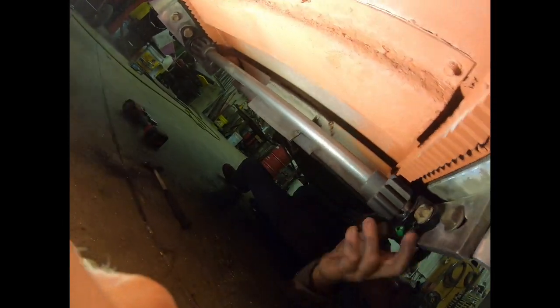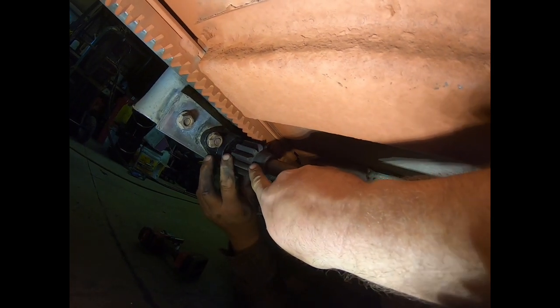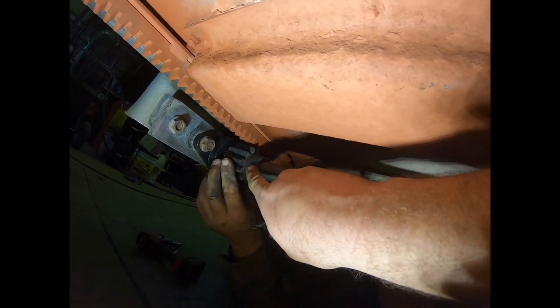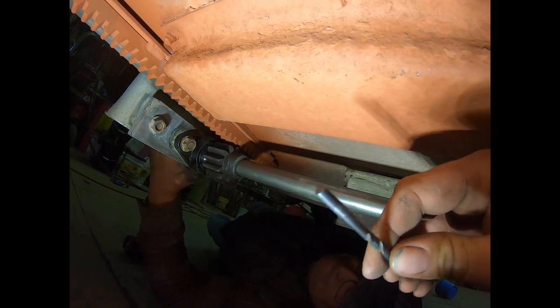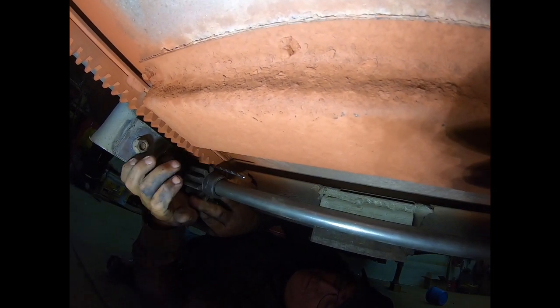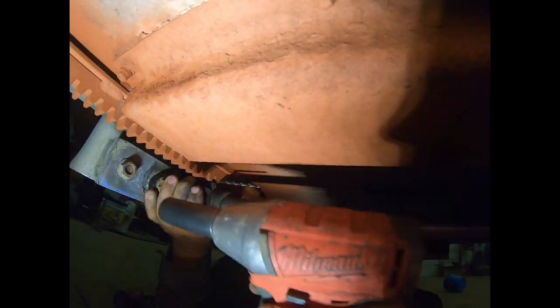We're ready to find our happy place for our gears in the gear strip. Make sure this part is towards the inside because it won't slide far enough otherwise — it'll hit the bearing race before the gear hits where it needs to be. We're going to take three-sixteenths drill bits and stick them in here, then push our adjustment up against there so it's tight like that, and then tighten the bolts up with the impact.